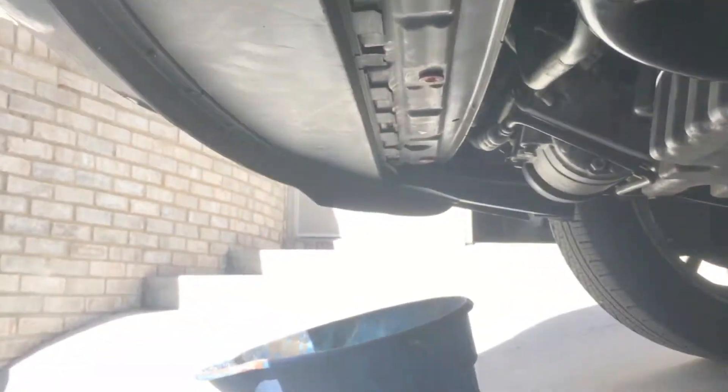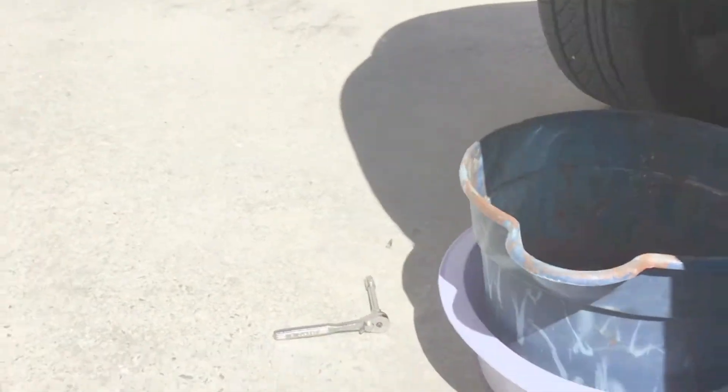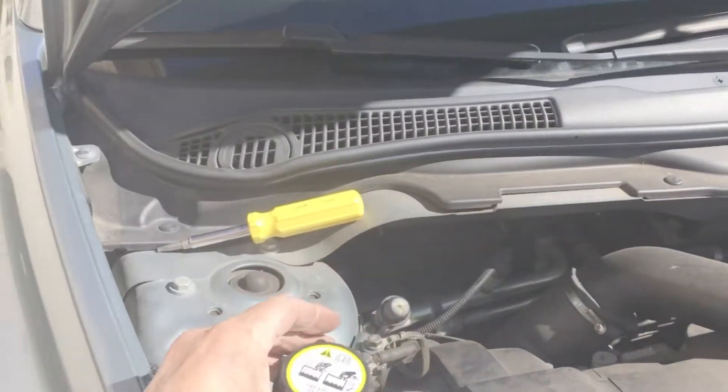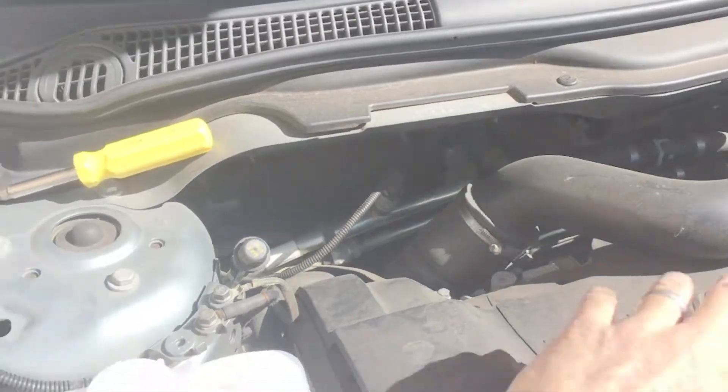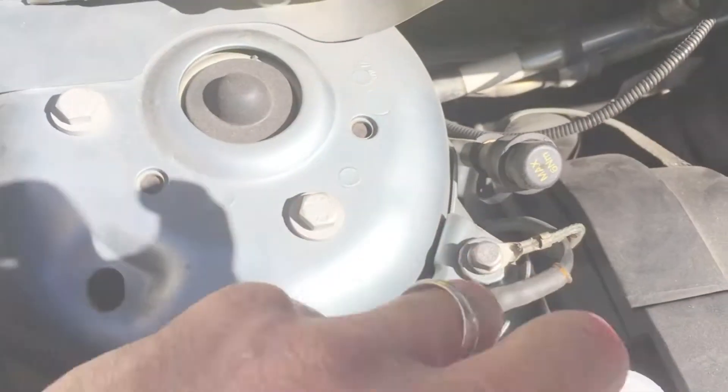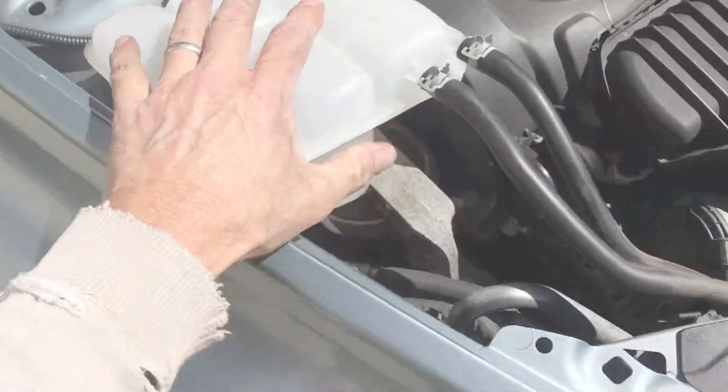The biggest trick — I've just drained my antifreeze, but before you get to your plug which is on the passenger side, you want to undo the cap to your reservoir. Take that off. You can take this tank loose — it's got a clip right in here that just kind of holds it on. There's a clip right back in here and it'll just pop up off. That way you can tip it up on its side and get all the antifreeze out of there so it drains out.